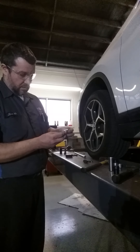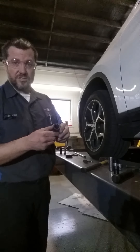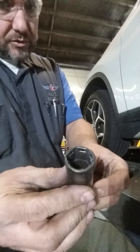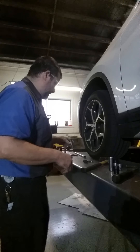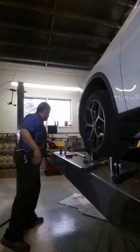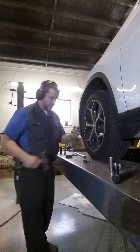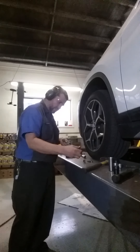He used a 15/16 socket; I'm using a 7/8, although I've already pretty much sacrificed this socket. I'm gonna use it again — if this lug nut comes off it'll get posted, if not it's back to the grinding stone. So I'm just gonna take the 7/8 and pop it over the locking lug nut.